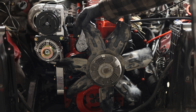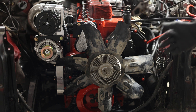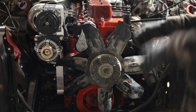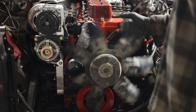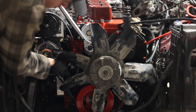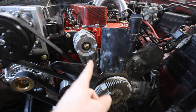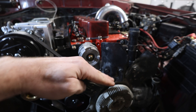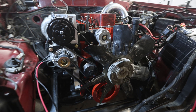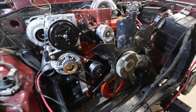We've also assembled the cooling fan with the fan hub attached. We want to clean it up but need the serpentine belt attached first since we don't have a means to get the reverse-thread bolt off otherwise. Now that it's tightened down, we can look at putting the belt on. It's something you want to do with another person — you'll need a half-inch breaker bar on the tensioner pulley to get enough slack to get the belt over the water pump. The belt is on, and we've made quite a bit of progress getting this bracket installed with everything lined up. It looks really clean.